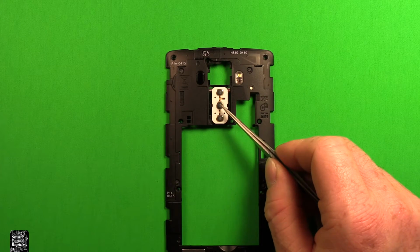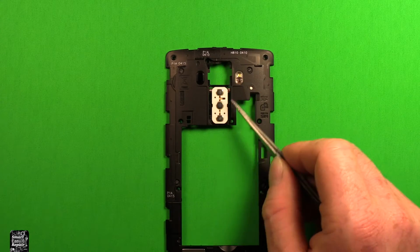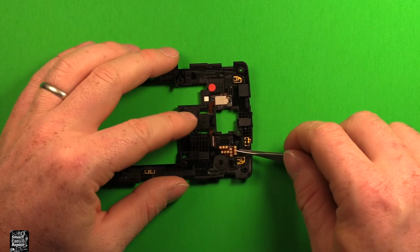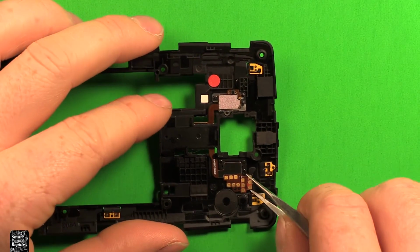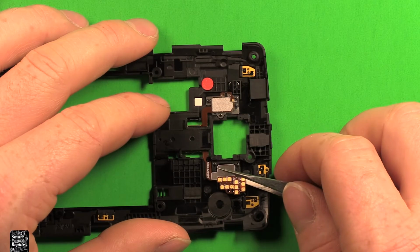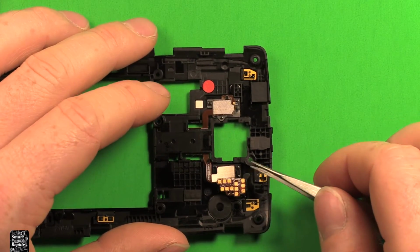So next, to change the power button switch, the volume button switch, the rear camera flash, this is all the same part. So what we're going to want to do is, first of all, flip this over, and then we're going to start loosening right here. I'm going to use something sharp to go underneath this. What you want to do is get under this little contact piece right here. You want to just get under it. It has adhesive on it. You want to just get under it carefully and slide it, and this whole thing has adhesive under it, but just carefully pry up, get it loose.